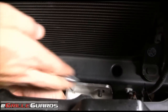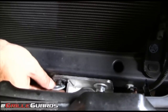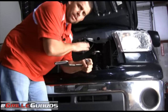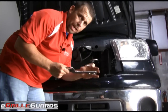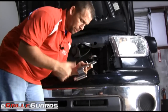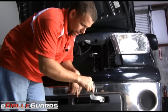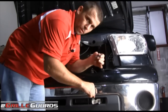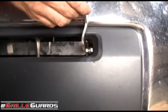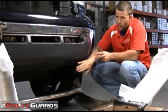Then you're going to use your flat washer and a lock nut to secure it on. We've just got done installing the main bracket for the grill guard. Now what we're going to do is actually attach the support strap to the main bracket, and they're actually identified by the letters L and R, which is left for the driver and right for the passenger. You're given two bolts with lock washers, which are going to slide through the rectangular hole and then attach the bolt from the outside. Now we'll jump over to the passenger side.